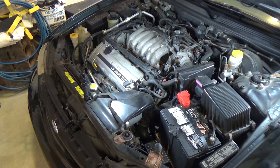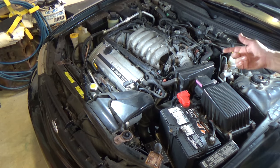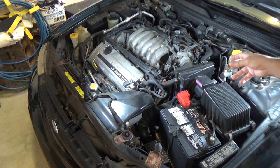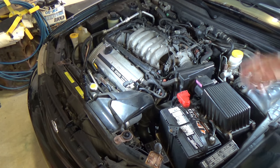The issue here wasn't the battery - that's the first thing to check. Make sure it's fully charged, and it was. So today's video I'm going to show you how to swap that starter out on a 4th Gen Maxima. Let's get down to the car and check it out. I'll start it a couple of times - maybe we can hear the Bendix getting hung up. It's kind of like a winding sound after it starts, sometimes a slow crank.